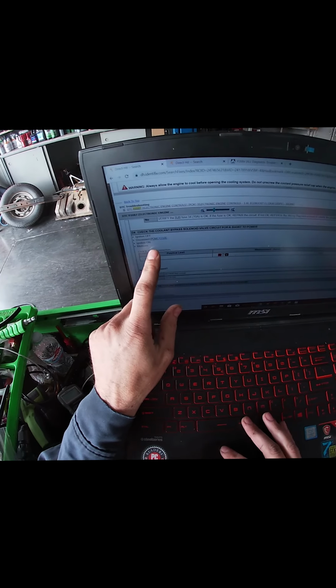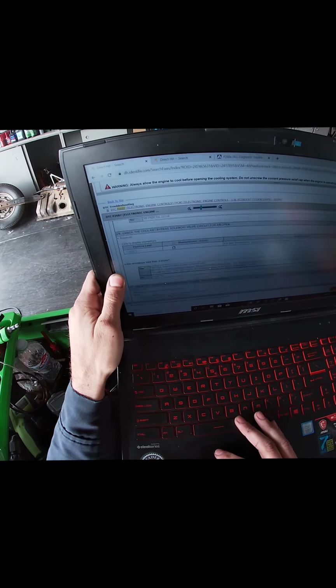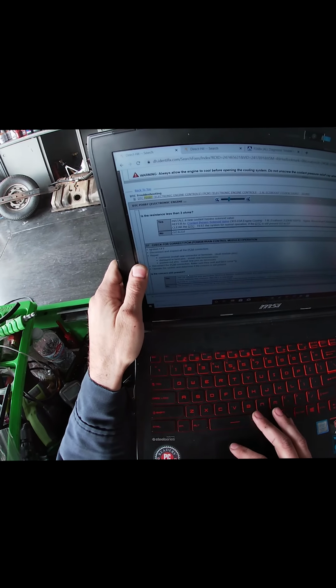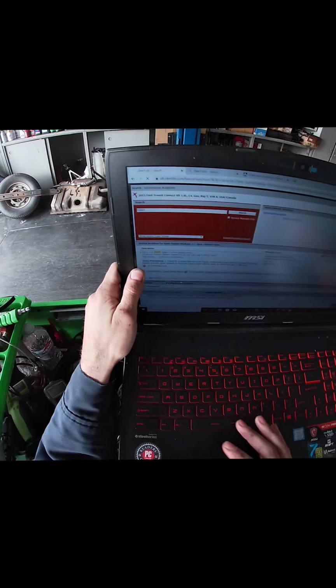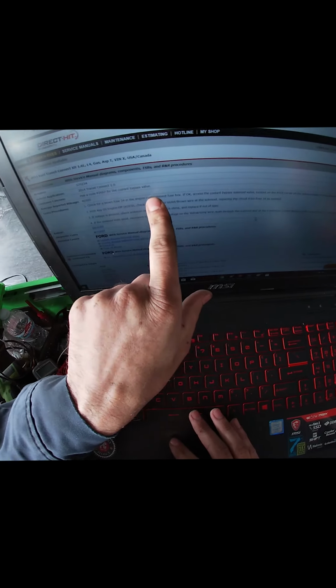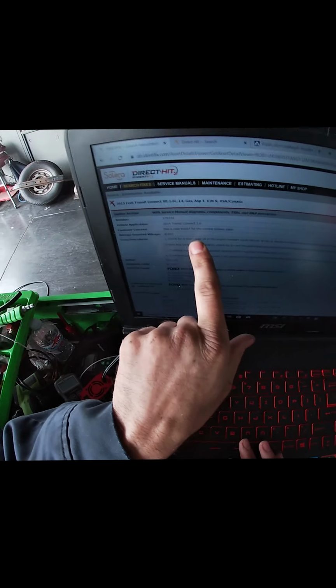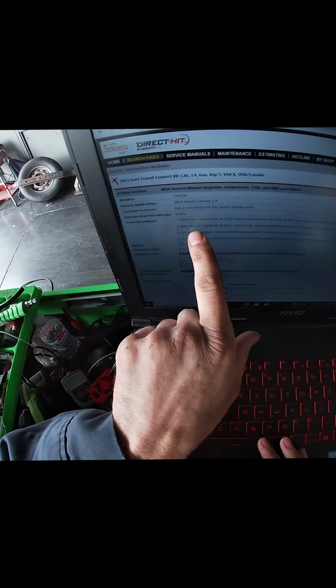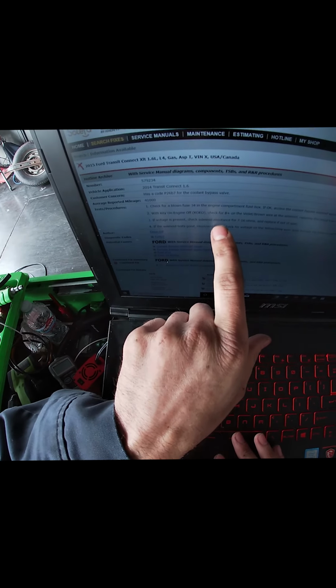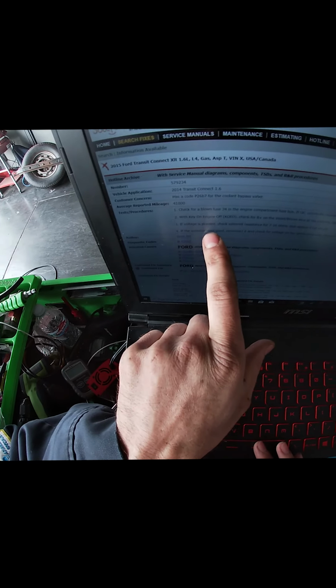And then check the valve for short to power, ground, that's good. Check the valve circuit for an open, and then check the computer. That's the manufacturer troubleshooting tree compared to what we normally should be doing. Check for blown fuse or check for power. This should be step one, because if you have power, obviously the fuse is not blown. And then if voltage is present, you check the solenoid resistance. No, that should be the last thing we do.